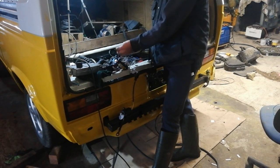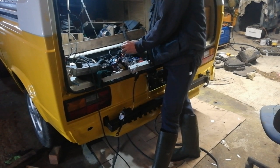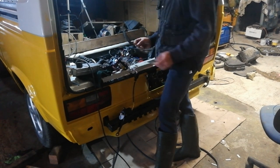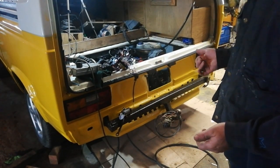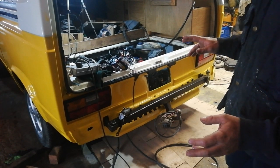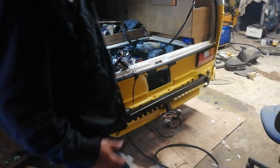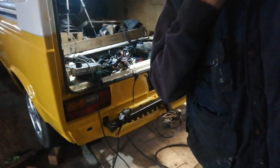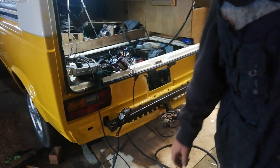The pump started cycling. Right, we have unburnt diesel out the exhaust. Volkswagens are generally crap without heater plugs, and I don't have it set up to run heater plugs, so I'm just gonna go put that fan on. We might get a bit of heat in the cylinders just doing that anyway. I don't have an easy start, not that I like it. I think it ruins a lot of engine start videos.